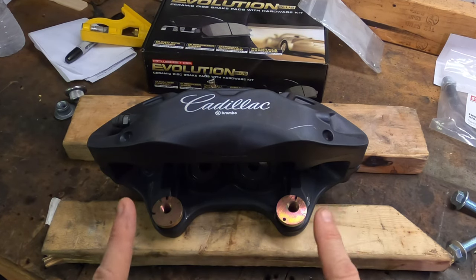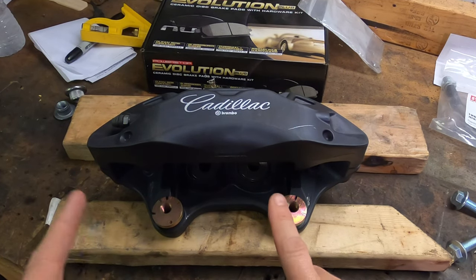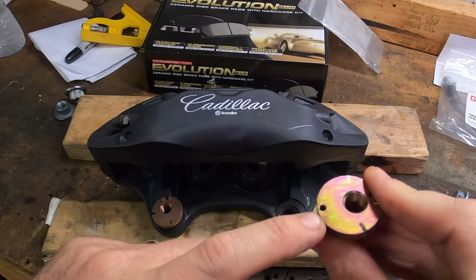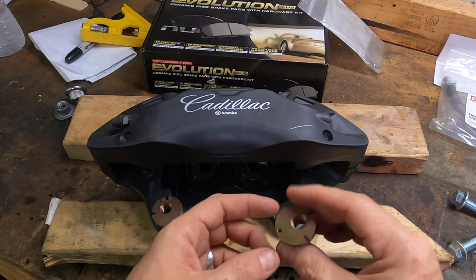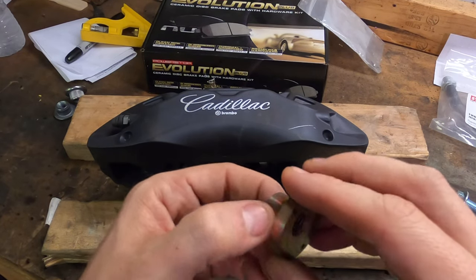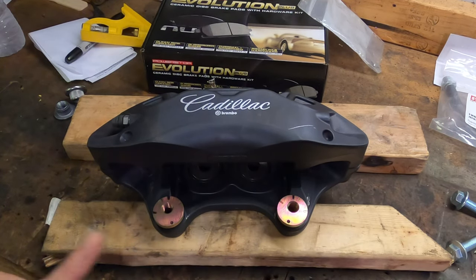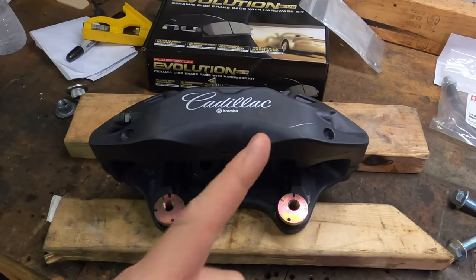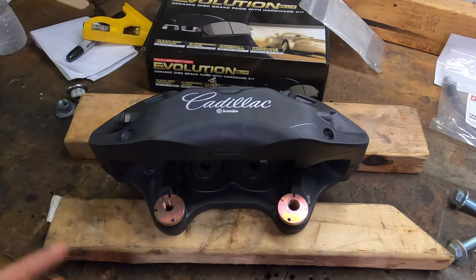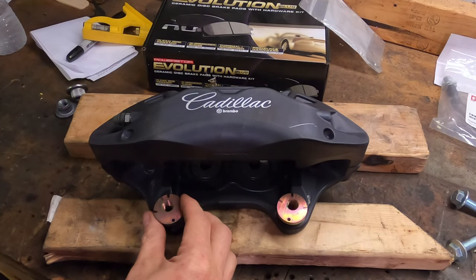You offset the hole to the corners of the caliper. My kit has dowel pin holes — holes drilled into the inserts. I talked to Chris yesterday and he said the newer kits no longer come with dowel pin holes and a drill bit. They increased the tolerances so the press fit is tight enough that they weren't moving, and most customers weren't even installing the dowel pins. But I'm going to install the dowel pins anyway to show how it's done on this kit.